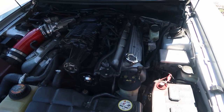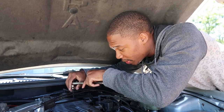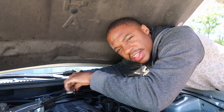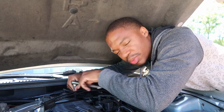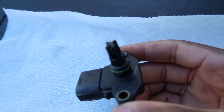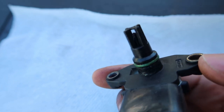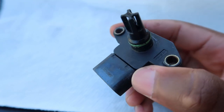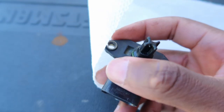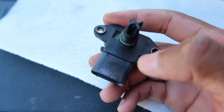I don't know how or why, but I'm gonna try to fix that right now. First things first, I have to take it off the car and check it out. Hopefully I don't have to replace the whole sensor — I can just undo it and see if there's an O-ring or anything in it and replace that. If not, I'll just put some RTV over it and hopefully that'll fix the problem. This is literally what the MAP sensor looks like, and as you can see there is an O-ring on it, but it doesn't seem to be damaged — it's just a little dirty or oily. So I'm gonna wipe this down with a cloth and then put a little bead of RTV around it to ensure there's a seal and no air is leaking out.